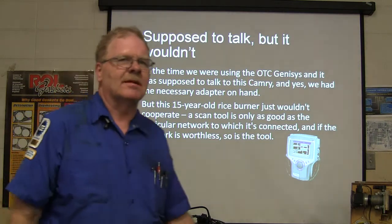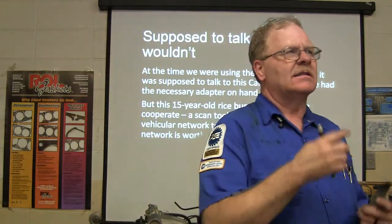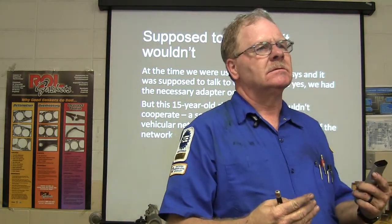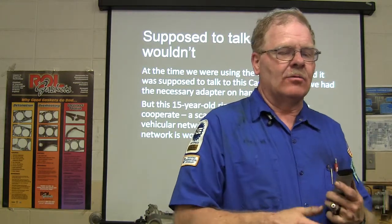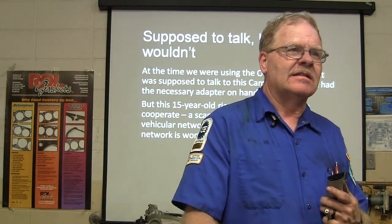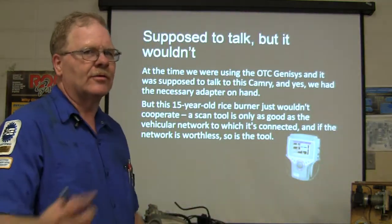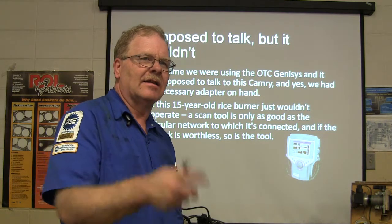So where do you start on something like that? Go through the basics. Yeah, basics is not a bad idea, but if you've got an intermittent, you really need to catch it in the act, don't you? And if you've got an intermittent, the worst thing you can do is start pulling on wire harnesses, because you may pull it away from whatever it's shorted to, and then it may not act up for several days. Then it's going to come back again, and they're not going to be happy, or maybe another wrecker bill. You know, who pays for the third and the fourth wrecker bill? That's not a good plan, is it? You've seen that kind of thing, haven't you?